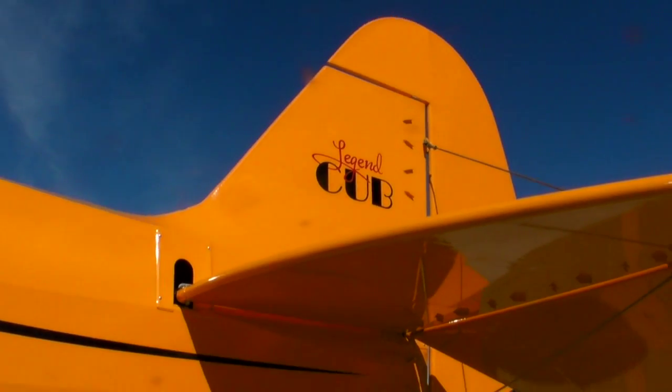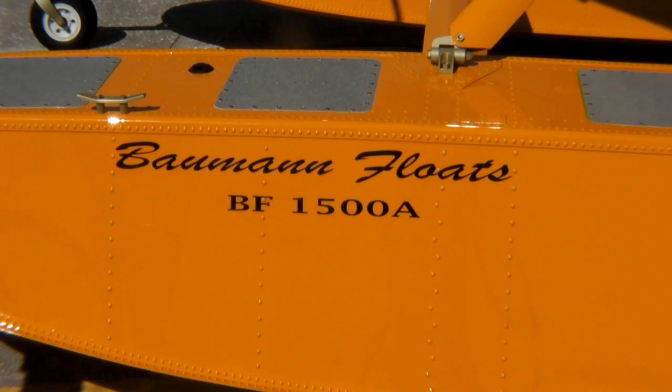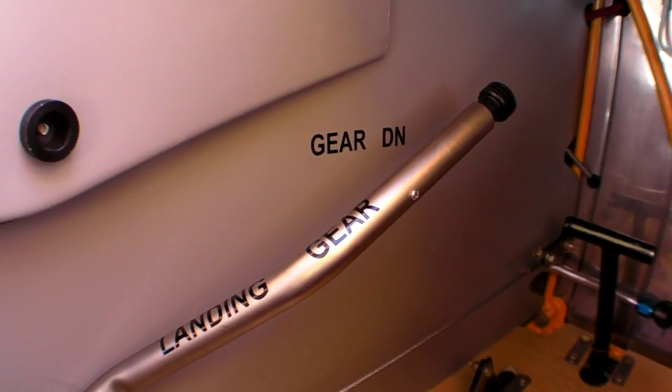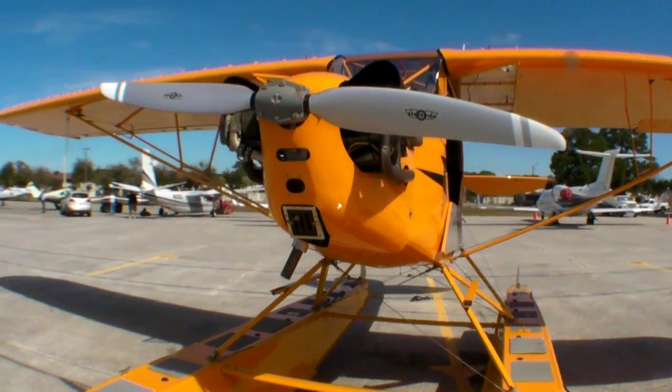Here's owner Dick Parsons to tell us about the Amphib version of this airplane. This is the first aircraft built as an Amphib Cub — it comes out of the factory as an Amphib. The floats are the Bauman 1500As, an Amphib float with a unique feature: the Johnson Bar manual gear. It operates with a Johnson Bar — there are no hydraulics, no electrics. This airplane is a single configuration airplane out of the factory as an Amphib due to the weight requirements.